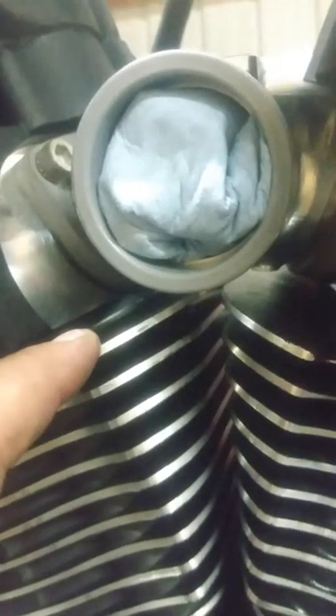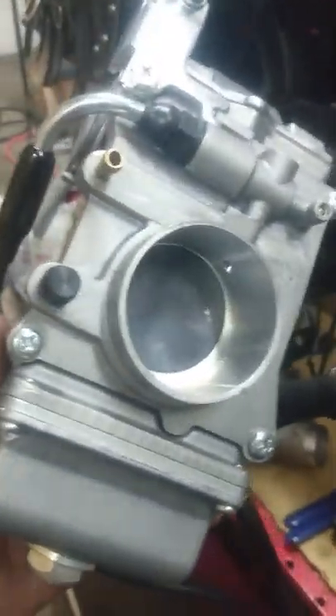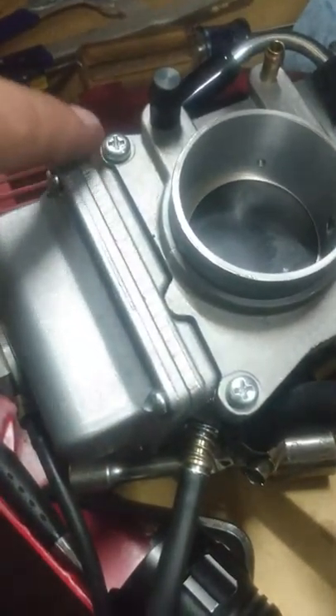I was told they would fit, aside from an exhaust manifold clamp not fitting or something. But right now what I'm running into here is this fin, this corner, and this corner sticks out too far for this Mikuni HSR45 carburetor to slide into the mount properly. Where it's hitting is right here on the float bowl — where the float bowl mounts up, right here at each corner, they're hitting on the corner of these fins before the carburetor is all the way in.